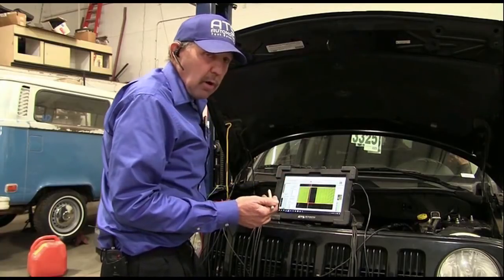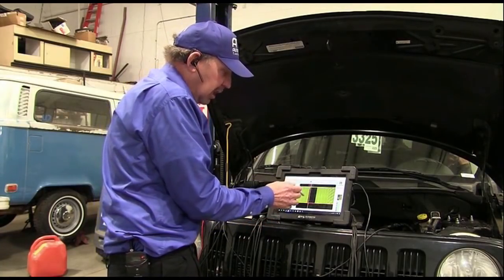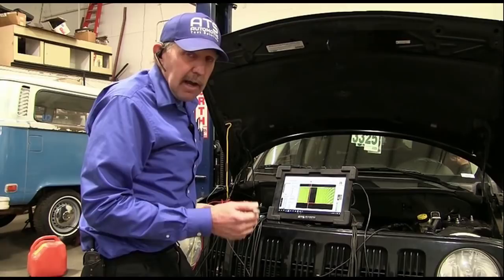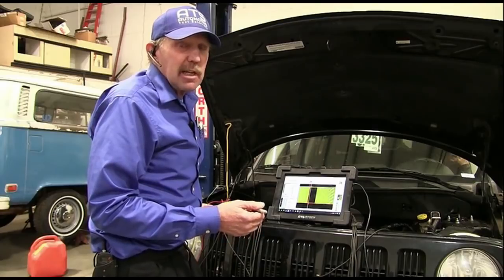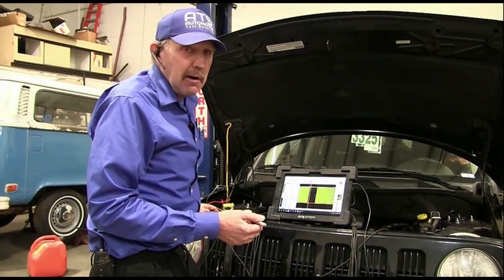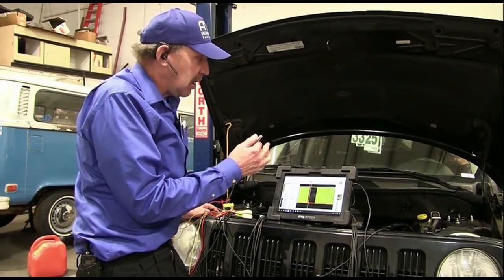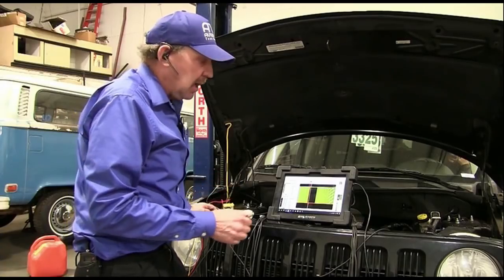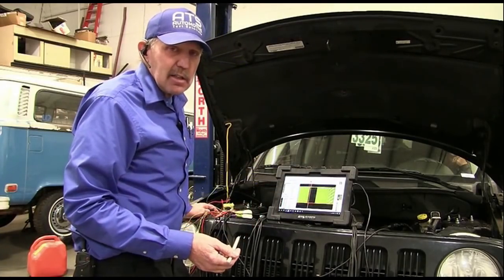And I still don't quite get how the coil current or the voltage is hitting the crank sensor. I have never seen this problem. And I have seen some crazy, crazy cars. And I've been using a scope since 1980. I've seen a lot of stuff using scopes on cars. And I've never seen this. I've seen a lot of coils hit computers and knock them. But I've never seen a coil hit a crank sensor and have the crank sensor fail.